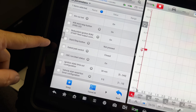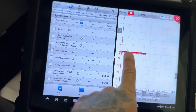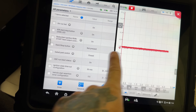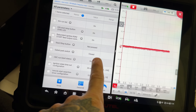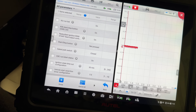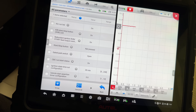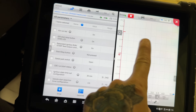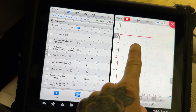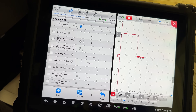Further down in the data I found the gated park switch, and right now we're in park so it's pulled low. This is what's actually the TRS park sensor — if I go out of park, there we go. So this saying open circuit — I'm guessing this 12 volts is actually coming out of the RF hub, and the TCM is pulling this low when we're in park.